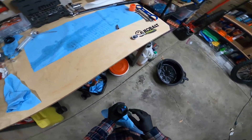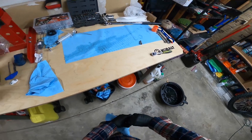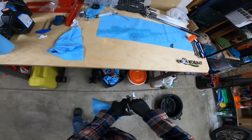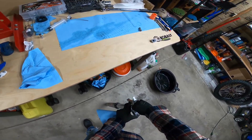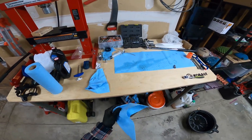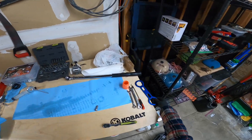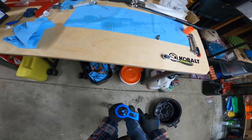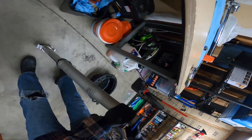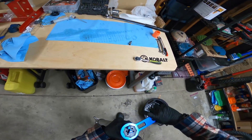So first we're gonna turn the clickers all the way out. Then we take the top cap off — this is just a 50mm socket. We'll see if this one's loose. The first one was actually really loose. Yep, I can literally just spin this off holding it in my hand — no vice grips or anything. I've tightened it down tighter as I put these back, because I don't like that — it's got a lot of threads on there, but I don't like it.